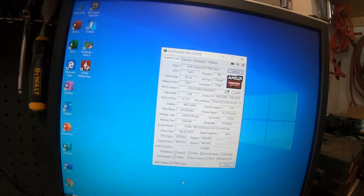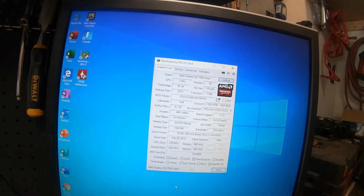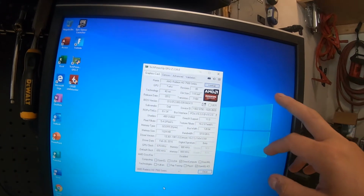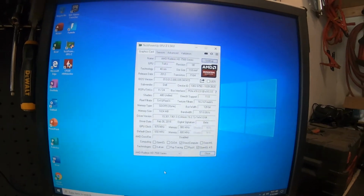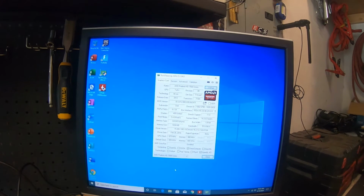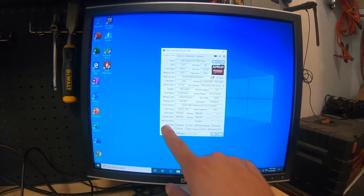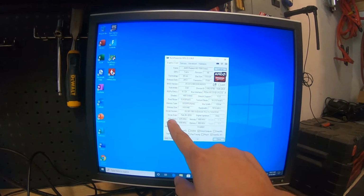So when you're using these older video cards, double check the manufacturer's website, AMD in this case, and check to see what the last drivers were that they had. Now, Windows defaulted to, I believe 2014 was the latest drivers they had for the Windows default, and this one is 2016. So newer drivers usually equal better performance in most cases, not always, but in this case the newer drivers do give us some better performance, and it lets us run the GPU at the extra 25 megahertz and the extra 100 megahertz for GPU clock and memory.